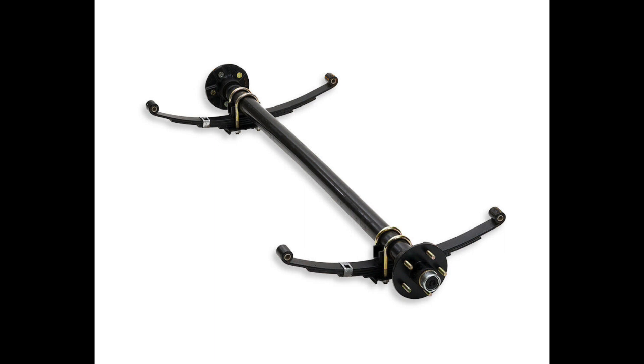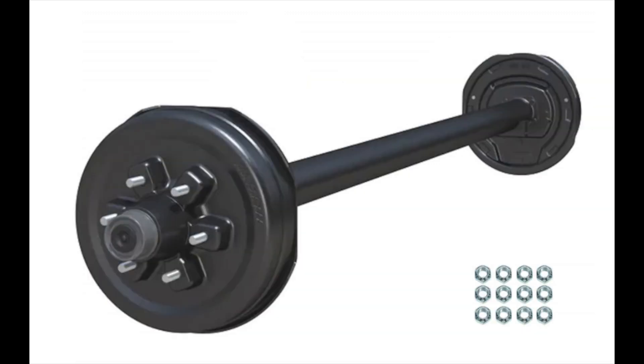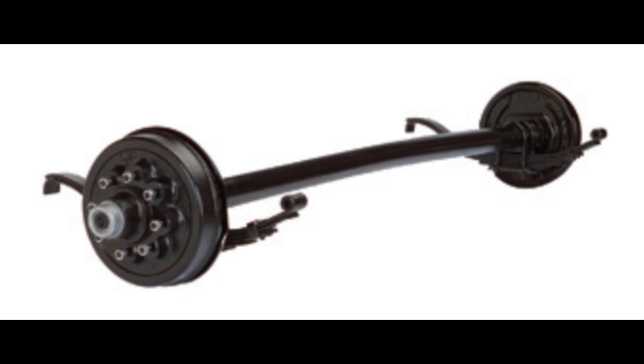The first question we ask ourselves is: what size trailer am I going to be building? I build trailers depending on the size of the axles available. We have 2,000 pound axles with four or five lugs, 3,500 pound axles with five lugs, 5,200 pound axles with six lugs, and 7,000 pound axles with eight lug axles. There are variations — the 5,200 pound axle can sometimes be a 6,000 pound axle depending on the bearings — but these are the main axles available.